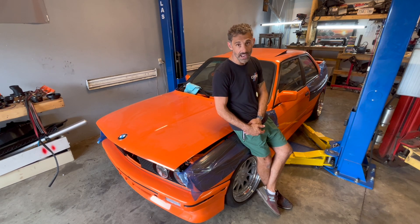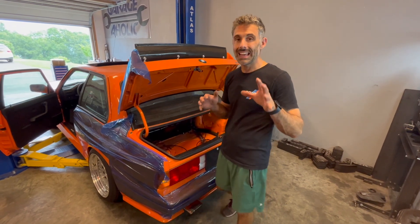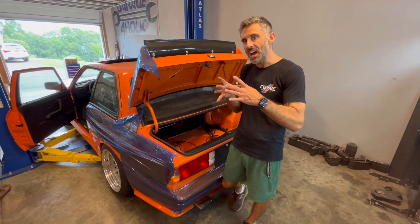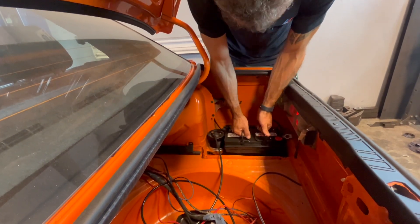Making sure that this car is completely up to snuff. In the trunk we need to install our battery in the location where the air jack is, so it's going to be tighter than it normally is because we've got that big air jack there now. The battery is going to be pretty tight - in fact it's going to be a bit elevated. We need to make a custom battery hold-down mechanism for that.